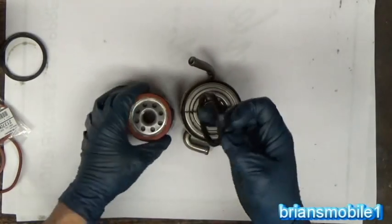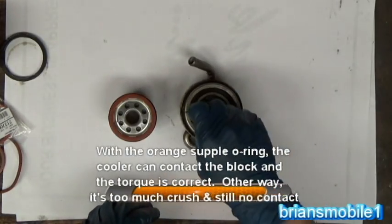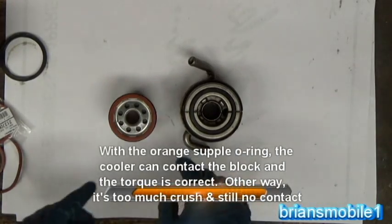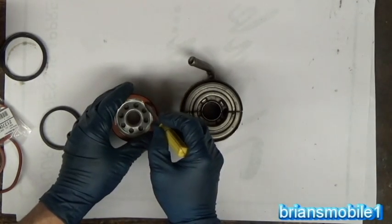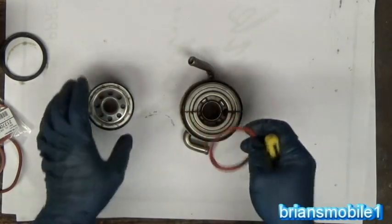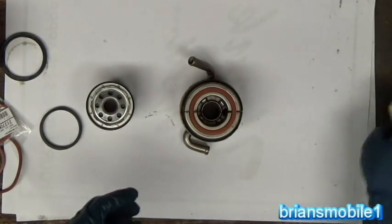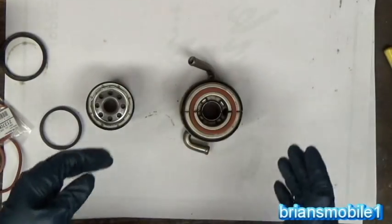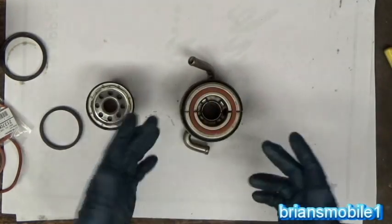The o-ring from an oil filter is the same diameter, but chances are really good it's just going to squirt straight out sideways. A better idea, rather than using an oil filter o-ring because they're too stiff and too tall, is to go ahead and reuse this o-ring. You just take the o-ring and use some gasket maker underneath, put this over it, and then use some more on top — that way you're glued in on all sides. Even though this is worn down and there's a gap, the gap can be filled.